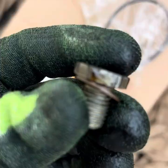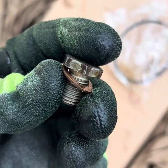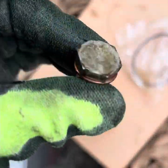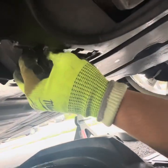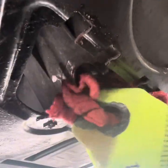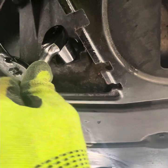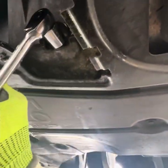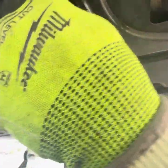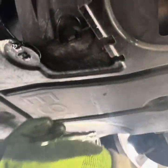Take off the old ring from the drain plug, put the new ring on it, and then wipe it down and put it back in. I got it started hand tight and just screw it in, wiping down the remaining area to keep it clean — no leaks. We got the bolt hand tightened, now just take your 17 millimeter socket, tighten it down. Don't over tighten it, just get it tight — you'll know when it's tight.